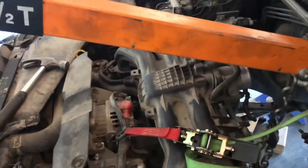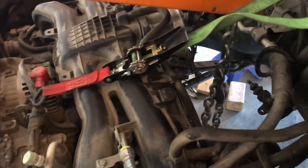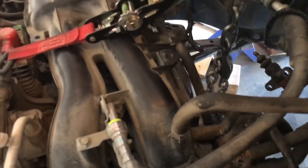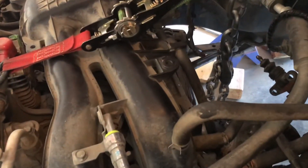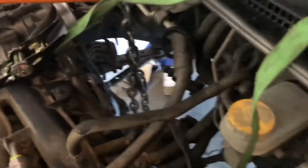I'm not going to really go into details on how I got the transmission out, except to say that if you're doing it in your garage like I am, it really, really helps if you can use some kind of a ratchet strap or something to pitch the engine back, so you're not trying to fight with the engine sliding the transmission out. You can slide that transmission out of there easier, and you won't be cussing and hitting your life.